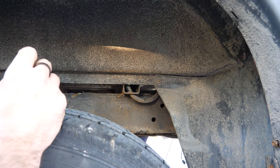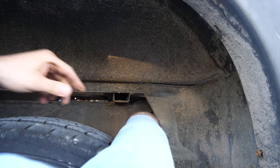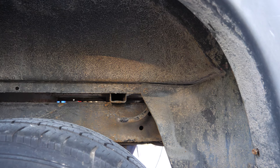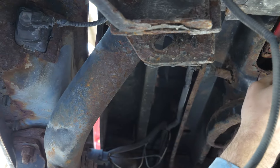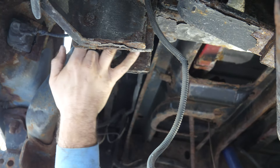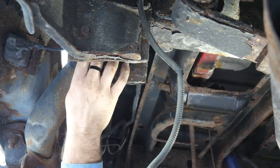I'm just going around the bed and checking for any last thing. It does look like in this case it's a differential breather, which was tucked into the bed as well. I'm just going to go around and make sure nothing else is connected. I was wrong about there being four bolts — there is actually about a foot behind that another set of bolts holding the bed in. So it's going to be six total on this truck.